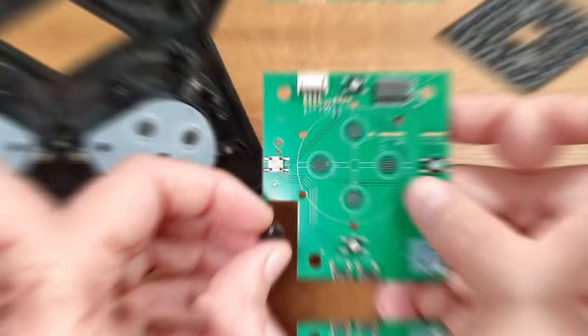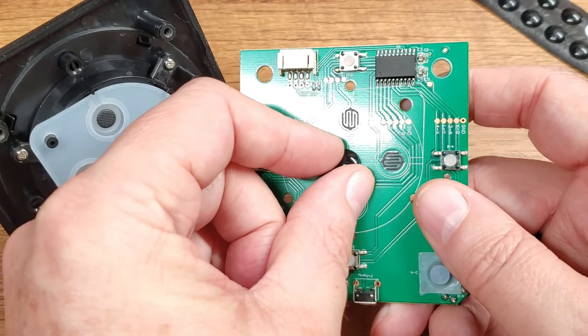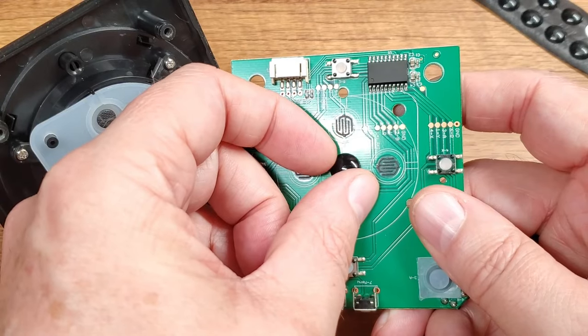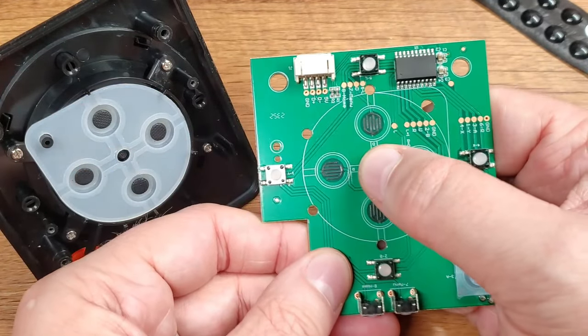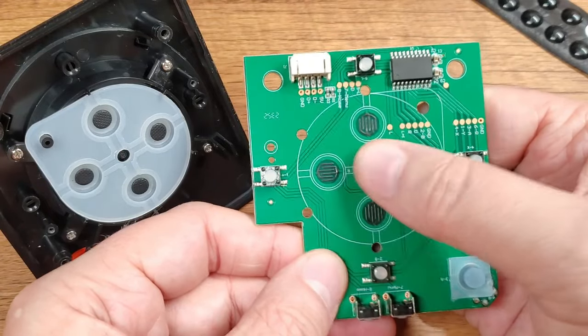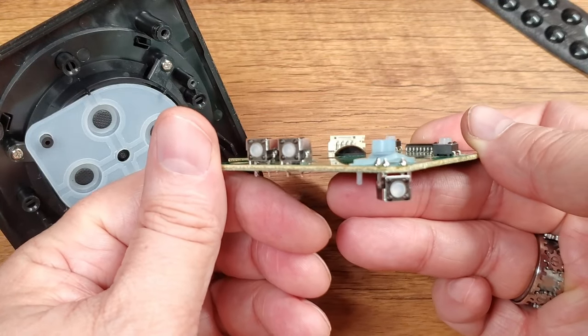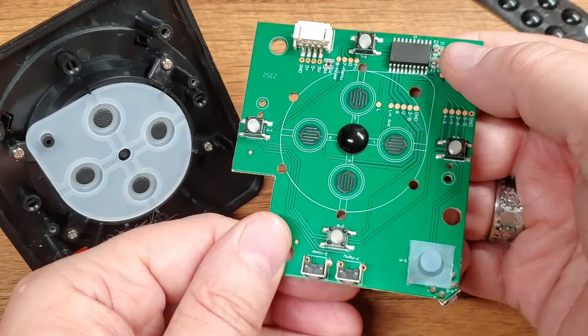I happen to have these little self-adhesive bumper pads — things I use on the bottoms of keyboards so they don't float around. I have these tiny little nubs — a tiny adhesive rubber dot meant to be a bumper. We put that right there, just as they did over on AtariAge. I bet we're going to see better performance here because we're not going to have the ability to deform this contact sheet and have it accidentally touch. This one is a tad larger maybe than the one I saw used in the thread over at AtariAge, but it ought to do the trick. Let's get it centered and press it in.